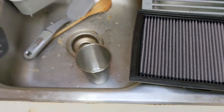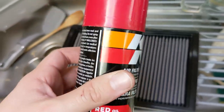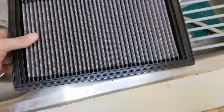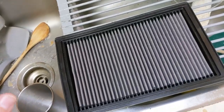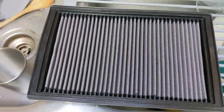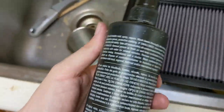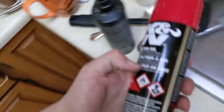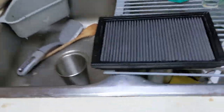The other thing I'm going to do is give the air filter a clean. I've done this once before and kind of rushed through it - you're supposed to leave these things out for quite a while, so I don't think I actually oiled it properly. Just give it a quick once over, go through the intake. I am going to go up the line as this stuff cures and probably get into cleaning the throttle body and the upper intake stuff too. Baby steps first - start with the stuff that takes the longest. Just give this a couple of sprays, wait a bit, rinse it out, do it again, then re-oil and let cure. We sprayed both sides pretty good, it says leave there for 10 minutes.